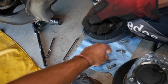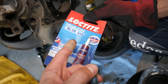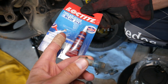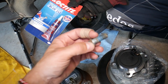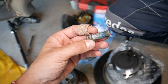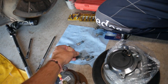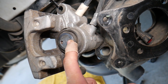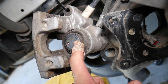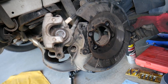All the old bolts had threadlocker on them — use blue threadlocker; we'll put the link in the description. Clean your bolts really well with a wire brush or rubbing alcohol, then apply threadlocker and install everything in reverse order. You will need to compress the brake caliper to install the pads — we have a video explaining how to compress a rear brake caliper on a Ford, so check it out. Thank you for watching and see you guys next time.